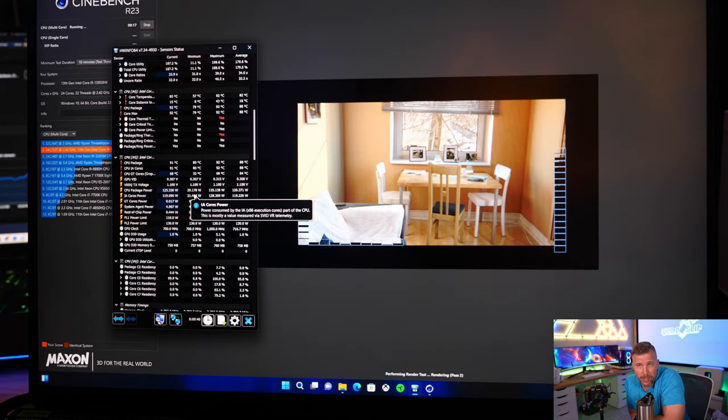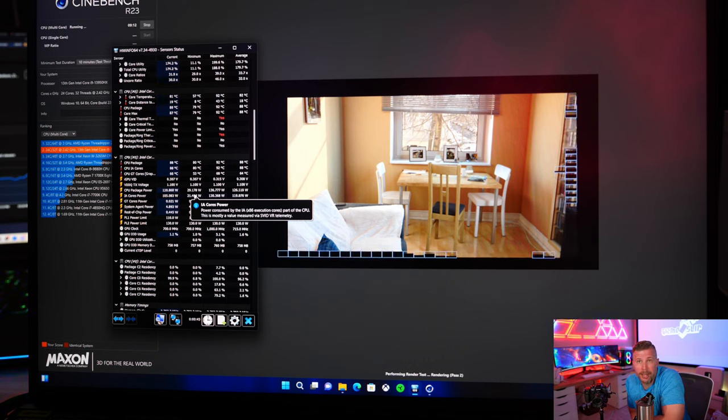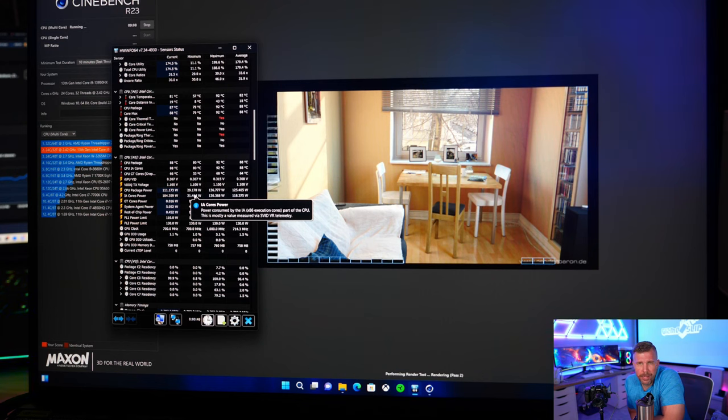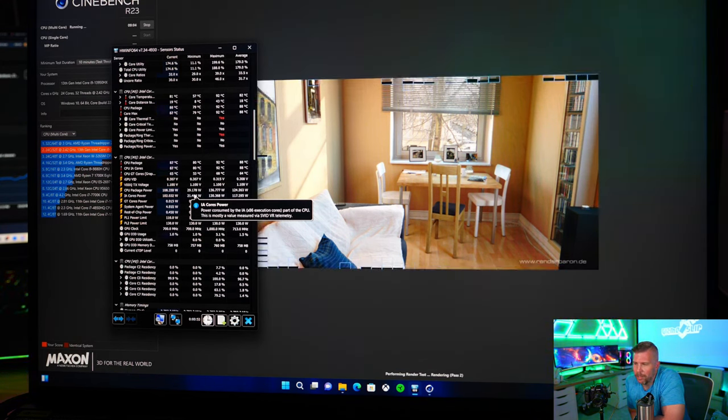But if you use Intel XTU, you can easily boost the TDP power limits to be really high because it's unlocked. I love that. Though if you're going to do that, you're probably going to want to uninstall Alienware Command Center or use Throttle Stop or something.